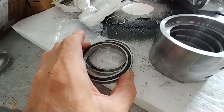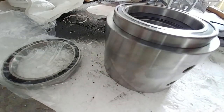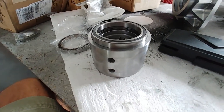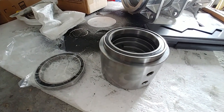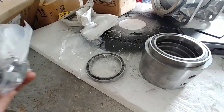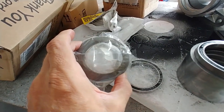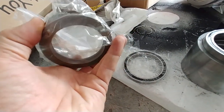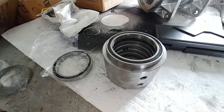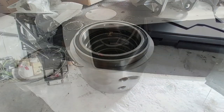These are the bearings I purchased — real narrow little things that need to be pressed in. They sort of start sitting in there but do need pressing. I don't have the press handy right now, so I'll probably just run these up to Brits once I've got the shaft — I definitely want to check them on the shaft and check the oil collar on the shaft before assembling those pieces. And there are the bevel washers — those are going to hold the collar to stop it from moving fore and aft on the shaft. I'll probably end up putting four or five of those in, whatever it takes to get it to sit nicely.